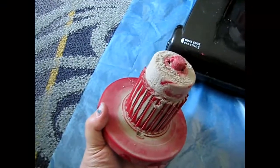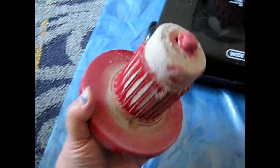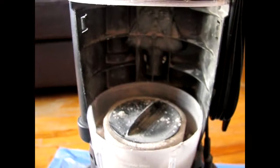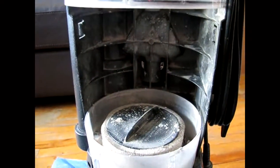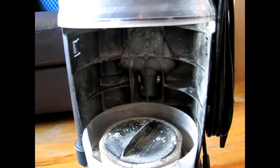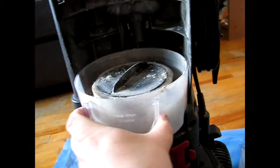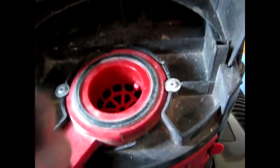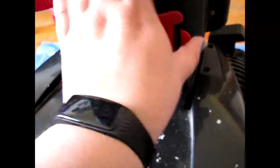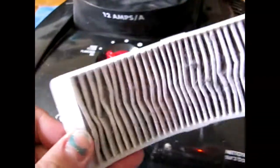Now this is the dust in my apartment. I think I'm actually picking up dust from a bazillion years ago, but that's okay. The inside looks all dusty like that. Don't rinse it deeply unless you let it dry well enough, because any moisture with this fine fine dust will just stick there and it becomes this weird kind of cement — I learned the hard way with my old one. This part also comes out; lift and pull it out. There's a little part here that comes out too. There's the filter, and there's also a filter under here — just click it open.